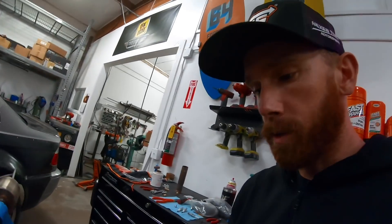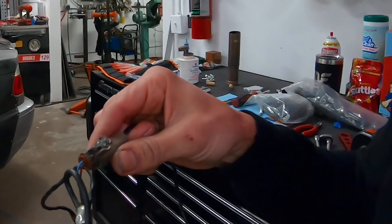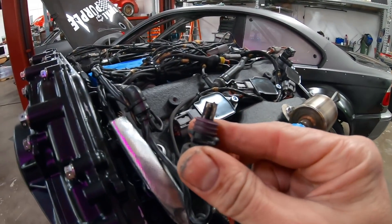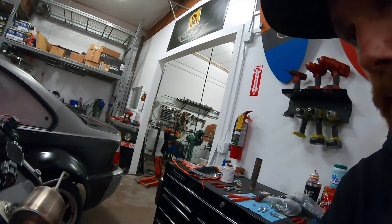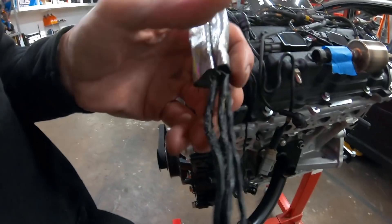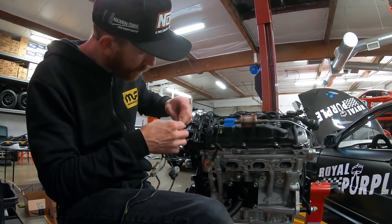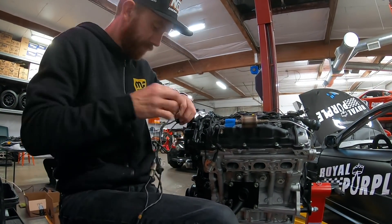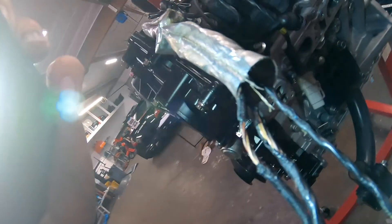While we're putting this harness on, just finding some little burn marks here on this plug, and then this guy got a little chewed too. That's why we had tape on that one - to replace it. Going to swap some of those things out. Doesn't look like any wires are damaged - definitely got through the heat shrink, so first layer of protection, you did your job. Nice work, brother. Definitely got a little crispy, but no damage on the physical wires.